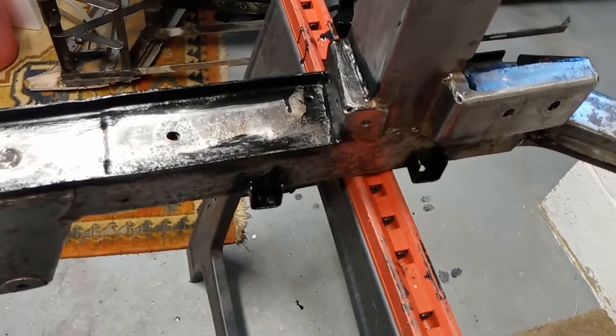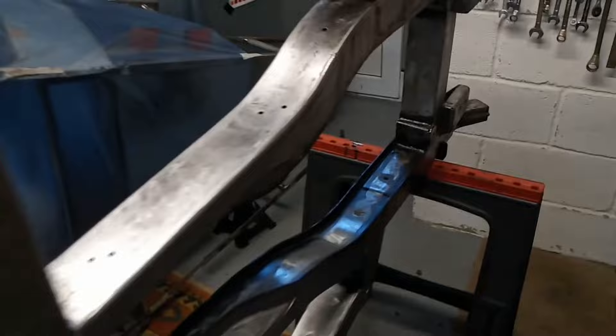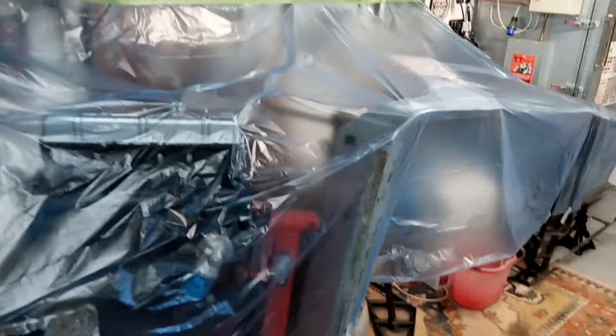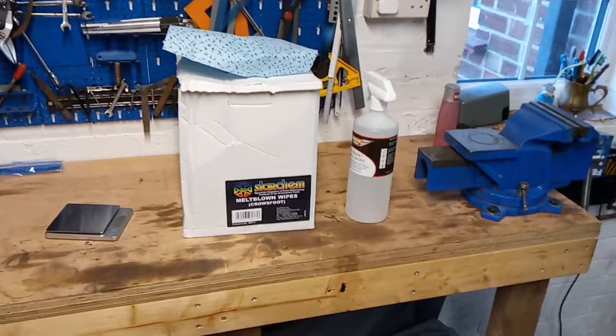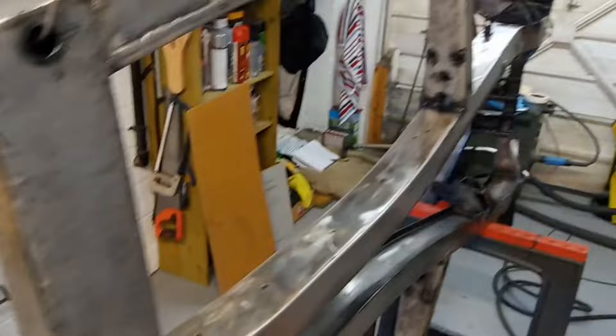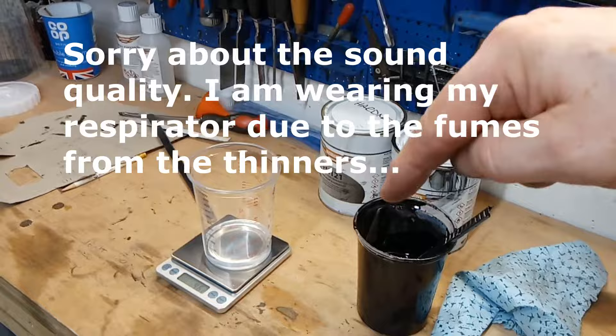At the front, that's behind where the suspension will be, so I couldn't figure any other way to do it — I will blend that in when I finish it and put it back into its right orientation. I've just gone around the garage and masked up with some polythene the areas that can best reduce dust. Under the bench I've covered it with a big sheet. I'm about to start mixing — I've got my scales, my cloths, and my panel wipes, so I'm going to panel wipe it all down, mix it, and spray it. We've got the hardener and the black mixed in the pot at a one-to-one relationship, and then the total weight of that — I worked out at 15 percent is thinners.